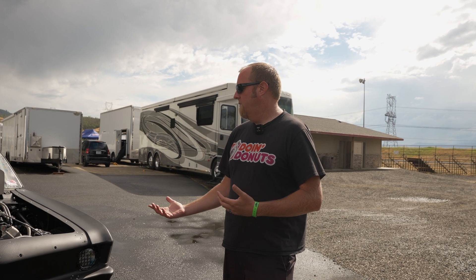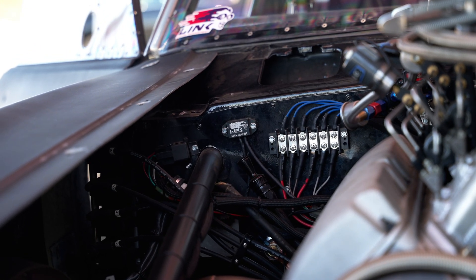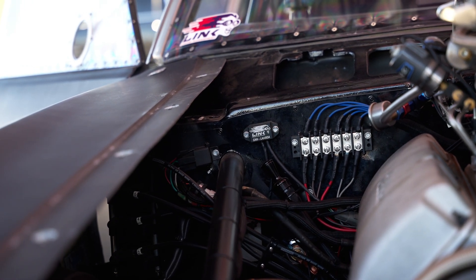No big deal. There's all this capability with it for the ignition side, power management, traction control, individual coils. With a nitrous motor, you'll find some cylinders are happier than others at different timing levels. You can do it a number of different ways — MSD has their way to do it — but individual coils is definitely the most effective and the fastest.